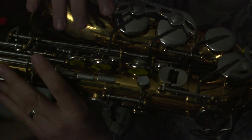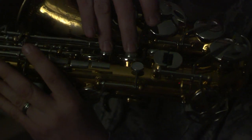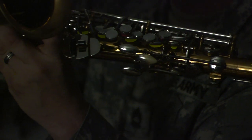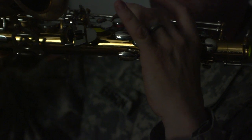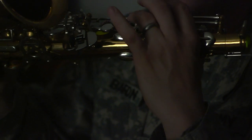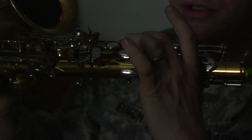So this is that nice thick yellow one and it puts out a pretty significant amount of light. This was where we had that leak before — does that show up? So the light needs to go down further. The adjustment for this one is that second screw next to the one that we dealt with a little while ago. If it doesn't have a screw, you'd need to put a little piece of felt or thick masking tape on there. The leak light allows you to see that.